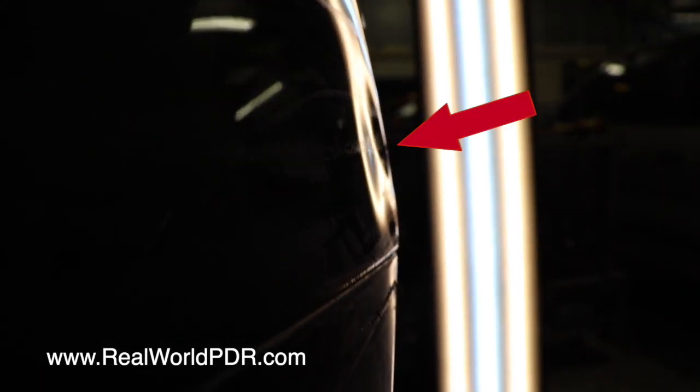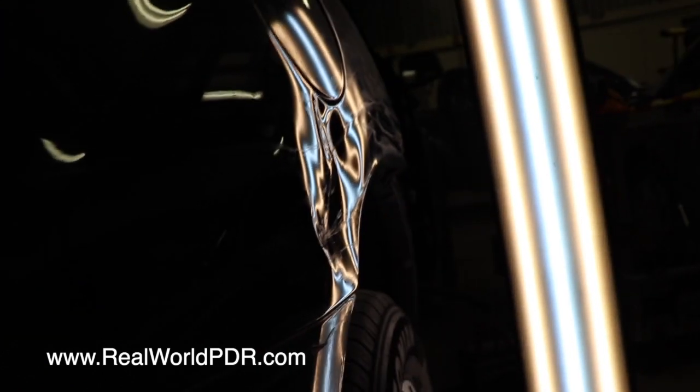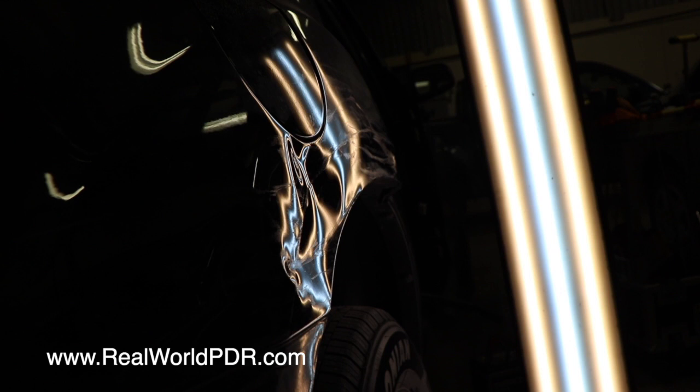Starting from the rearmost part of this dent, you can see that there's a point right here that the metal has crumpled over on itself. That's cool. Also, there's a pretty large crown that's occurring back here. Now, the crown was in an open area, but most of this dent was glue pulled, really limited access. Also, you can see there were no smooth, nice round dents here. No, that is crumply and jagged and ridiculous.